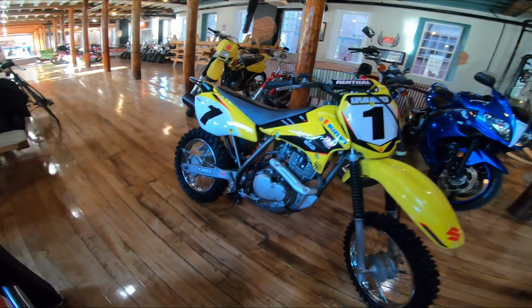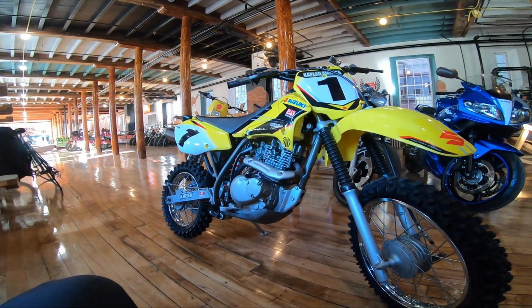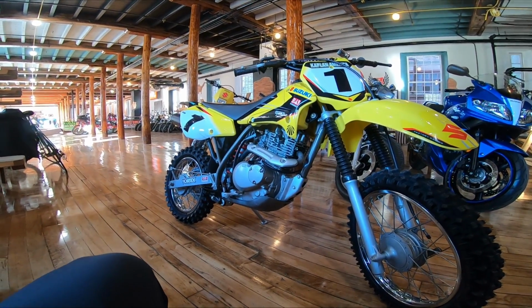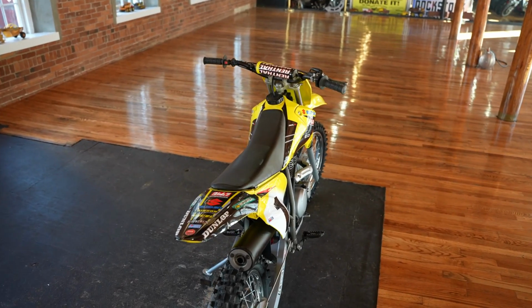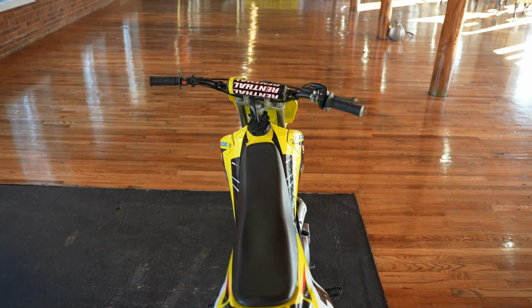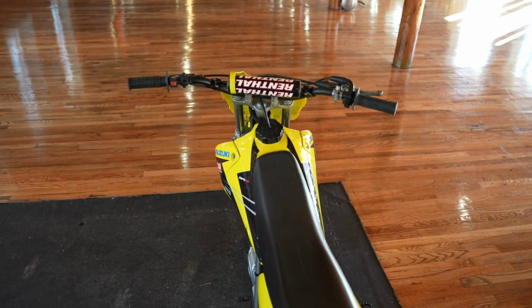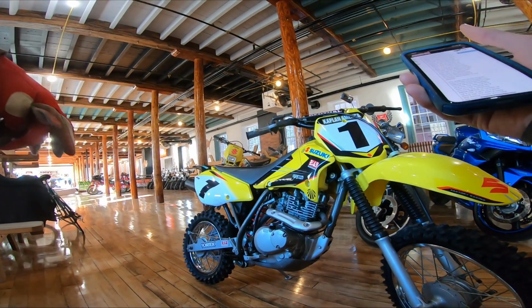This is the motor that Suzuki and Kawasaki use in basically every one of their play bikes. It's a heavy motor. It's very rigid, indestructible, and I think they had it figured out because the 100, 125, 185, and the 200 were all sleeved up and down versions of what you see here, and then eventually getting revised for the bigger bore, the 250, which we're going to ride later.